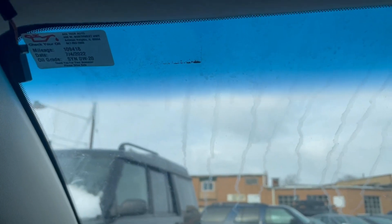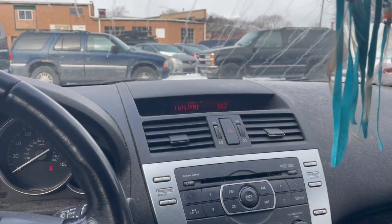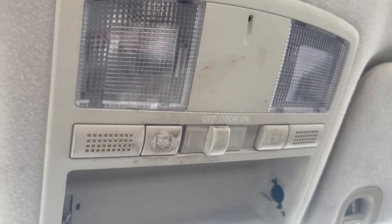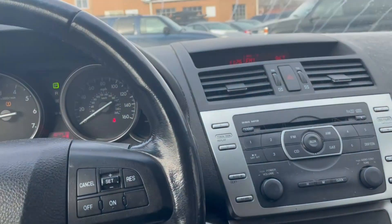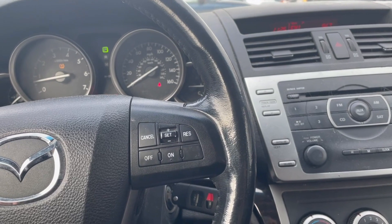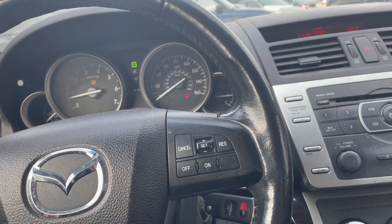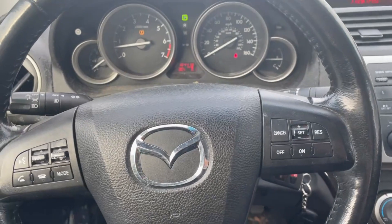So if you guys are having this kind of issue with this fuse, I would start at the easy spots first — take out the sun visors, this light up here, disconnect the connectors in the back, try those out. Hopefully it's one of those; those would be the easiest. Otherwise you'll have to get into fancier things — unplug the radio and the cluster, and if that doesn't do it, go into the door panels and disconnect the lights off of those. Hopefully this video helps you out, and hope it's an easy fix. Thanks for watching and good luck with the repair.